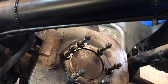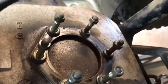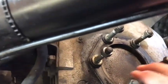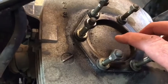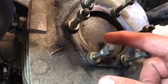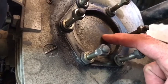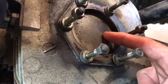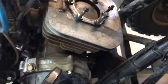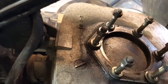So I'm just going to pull this up — see if I can hold this and pull it at the same time. Hear that? It's tough to tell if that's the connecting rod pushing down on the crank pin or if that's the wrist pin tapping against the bore on the piston. I have a suspicion it's actually the wrist pin. But either way, it gives you a little further information as to what's happening there. That shouldn't be there, just so you know.